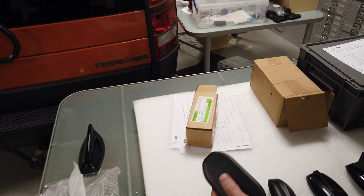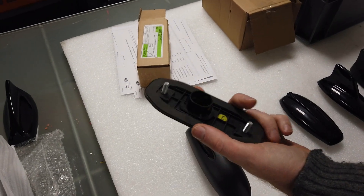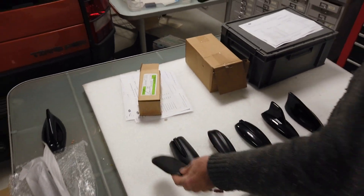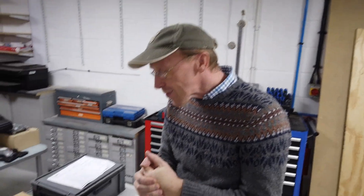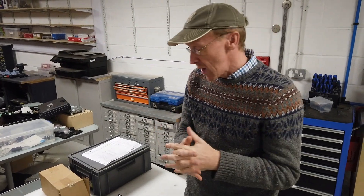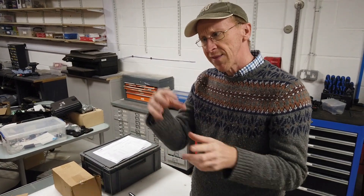Some cars will have a blank. That's bad if you've got one of those - it means you've got no GPS. So the roof aerials are for GPS, which is looking at satellites up in the sky and giving you your satellite navigation. They are also for your mobile phone connectivity, which is GSM. I think some of them may also do some radio or TV reception, but I'm not sure on that. Some of them are fitted to the rear windows and stuff.